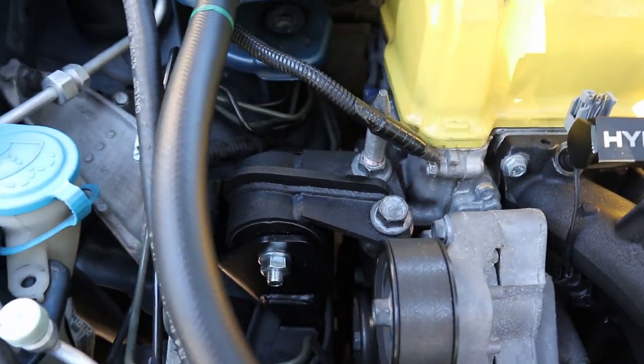This is where I'm ending the video. If you want to look at the mount one more time — there it is, looks really nice. It felt amazing driving it, no issues. I do notice the motor is slightly slanted, which I think is because of the trans mount, so I'm gonna jack up the trans and put two washers on the chassis side to try to level it out. Everything's solid, looks good, feels good. If you need these mounts, go to innovative mounts dot com. Please leave a like, comment, subscribe — peace!